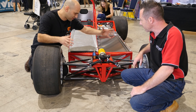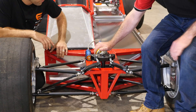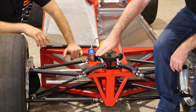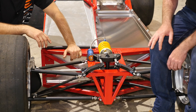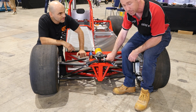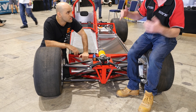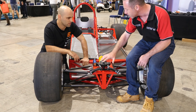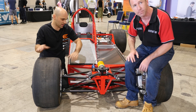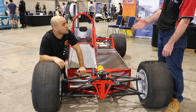So what we've got here at the front looks like proper racing shocks - like Formula One. These particular shocks are a titanium and magnesium shock that actually come out of a Benetton F1. This bar here takes control of what would normally be a sway bar, so this rocks backwards and forwards. We have a rising rate on our rockers - so basically once the aero kicks in, we then get back to normal suspension. In the event that we find we don't have enough control over it, we then just add individual dampeners to deal with each side. Basically all of that scenario lightens up quite substantially - the sway bar becomes extremely small and all components are minimized as much as possible.